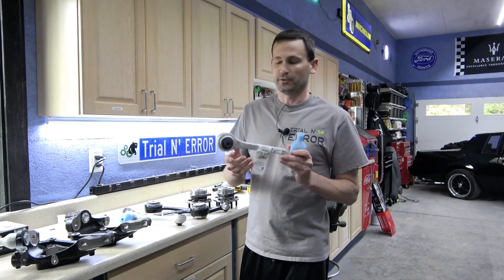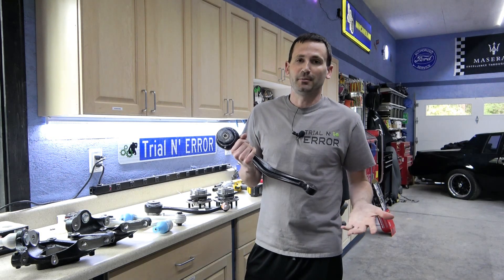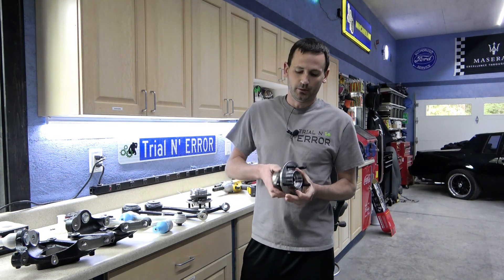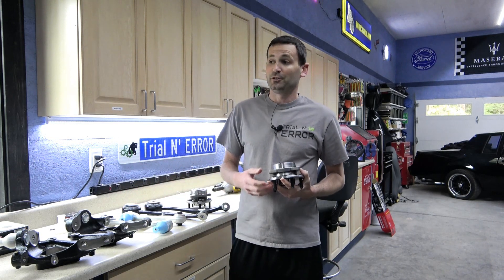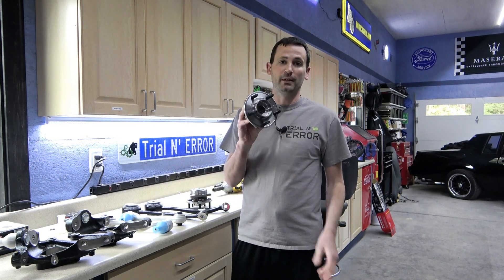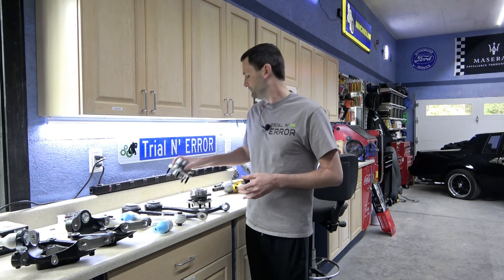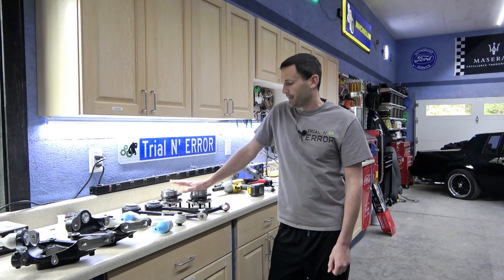This is one of the rear trailing arms on the lower section of the front suspension, so we're going to change that out. This is the front trailing arm — I don't think we really need to change this, but once I'm in there let's just do it all. It's got a big bushing in it we're going to replace. Also getting a little bit of whirring on the driver's side, so I picked up a couple of new front bearings. These need to be pulled as part of the process to get into the spindle. You will need a puller — you can pick one up at Harbor Freight for about 80 bucks. We're going to change everything on the lower front suspension of a Cadillac ATS.